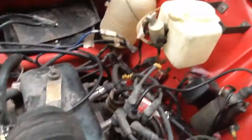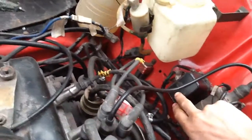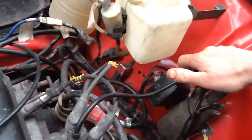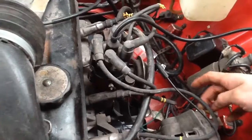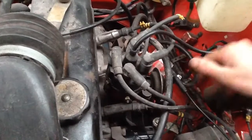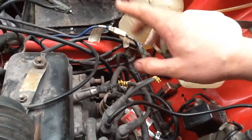And we have an ignition problem with the ignition light, so we're suspecting that it's a voltage regulator, but on these ones, unlike the Renault ones, you can screw them open. So I have opened that and cleaned both sides of the breaker contact points. Still no real joy out of it. The alternator seems to have one earth, one live, and a backfeed coming from the voltage regulator, coming from the ignition side of the live.